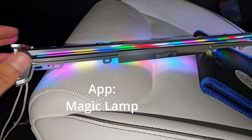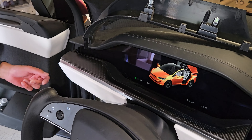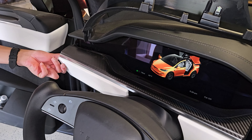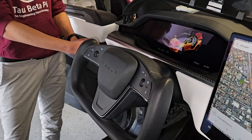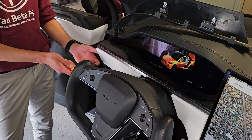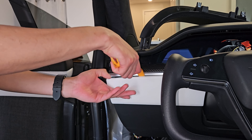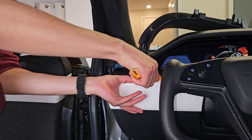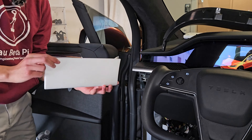Just for testing purposes I've plugged in these lights, got into the app, and the lights should be going. With the lights on we know this works, so we can now put it into the dash. The next thing we're going to do is get this top dash out — this silver accent is what we're replacing with the new pieces from TLYELF included in the kit. We'll take a pry tool and push the panel away from the car and it'll come off like that.